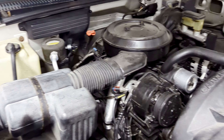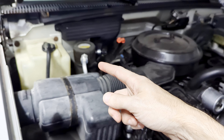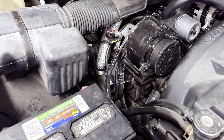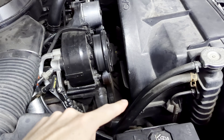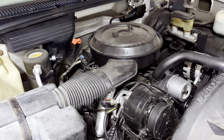The reason I'm hesitant to do that is because then I have to open up the whole system, pull the refrigerant out, change the compressor, and I'd also need to change the accumulator — anytime you open the system you want to do that. I would also be changing out the orifice tube, which is either located right here or down near the inlet to the condenser. But I don't want to open the system if I don't have to, and that's where the parts cannon comes in.